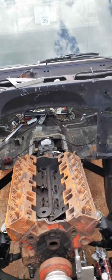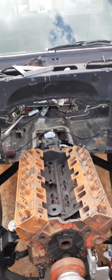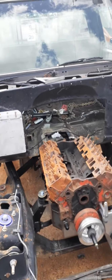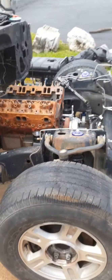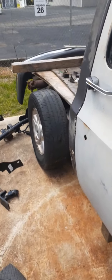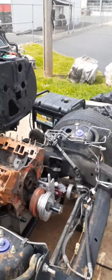Anyway, once I get this cut out I'll get back to you. Now that part of the cab firewall is cut out, it's time to start wiggling this cab forward. I'm gonna bring out the fenders and the core support, get them all bolted on and shimmed out where they're supposed to be, make sure I get the proper alignment with the front tires, and the next step would be mocking up the cab mounts. Super excited about that.